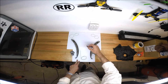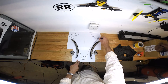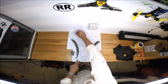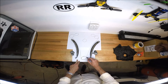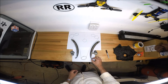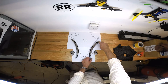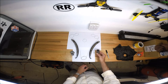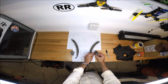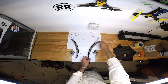The chains are going to be running through the pathways up in here, and I think there's another guide somewhere in there. Basically the chains ride on these guides. As the engine rotates, these guides are pivoting and being pushed into the chains to hold tension. They're being pushed with these tensioners, which are driven by oil pressure.